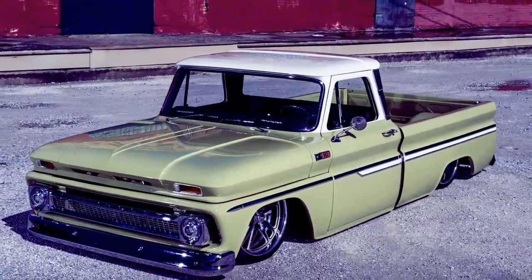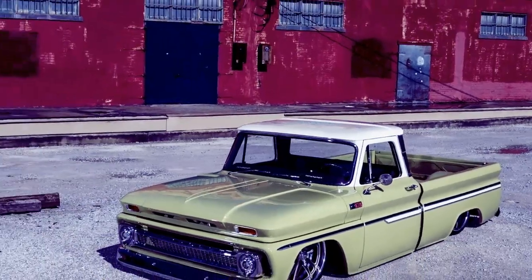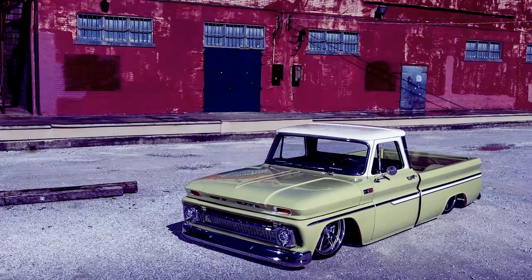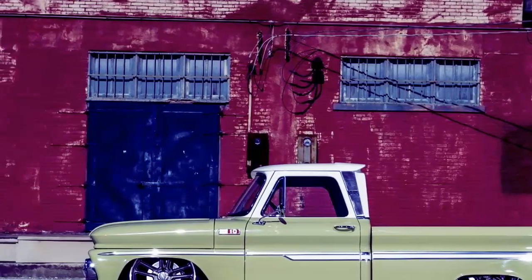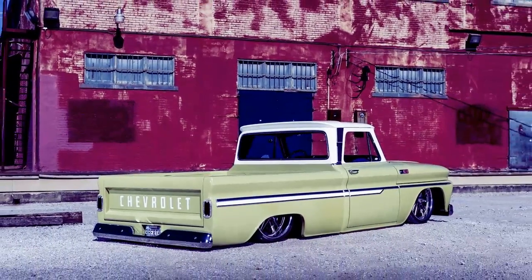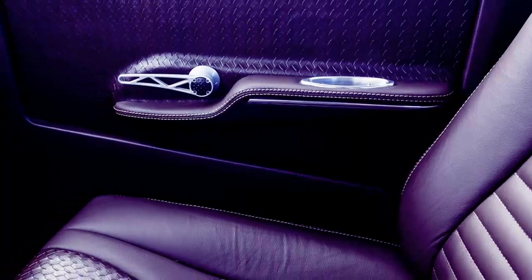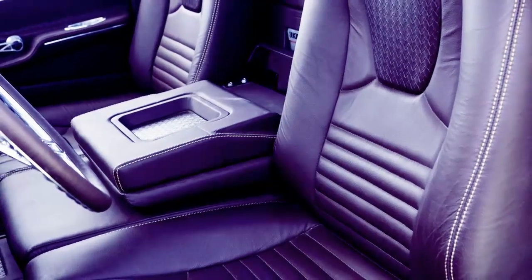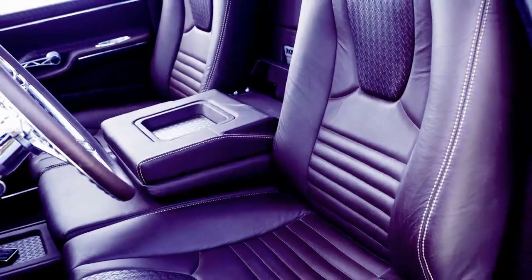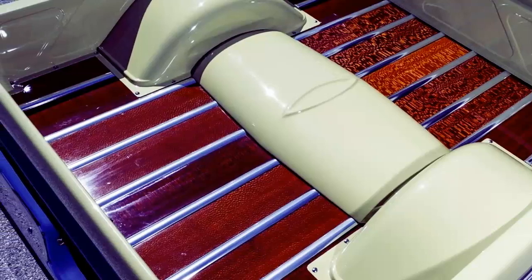After those components were installed, the frame was bodyworked and painted by Clem Johnson of Tuba Trucks. Since stopping on a dime can be a priceless ability, especially with a full-size truck, Mike chose to install an SSBC big brake kit with a massive four-piston caliper set. Under that, a large set of cross-drilled and slotted rotors not only enhanced the look of Bertha but the performance as well. A CPP Hydro Boost brake system was tucked away beneath the dash mount to keep everything functioning as it should.